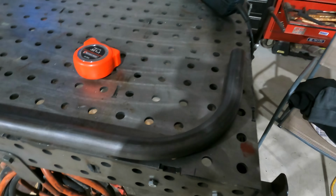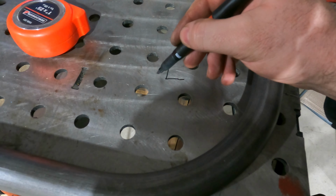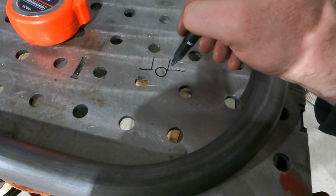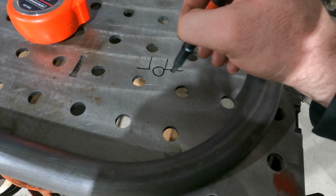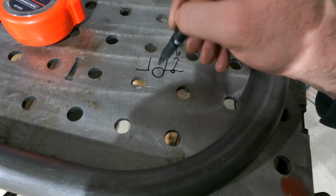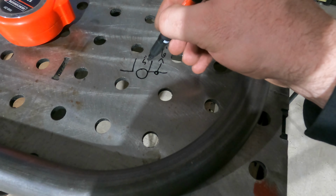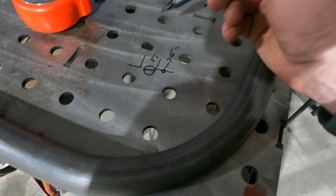So what I want to do is, if this is the corner of the intercooler like this, I want to rest this tube up like that, and then we're going to put the corner of the radiator back here. But I want this tube higher so that these can kind of sink inside. So if I know that that point from here, the bottom to there, is 6 inches, I want to make this guy about 5. So I guess what we could do is split that. We'll make it 5.5. That'll put us just a half an inch down into this tube, which is almost centerline.